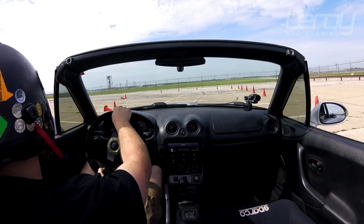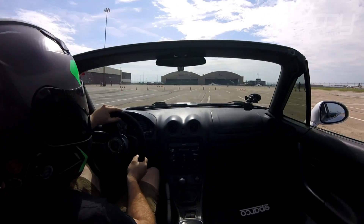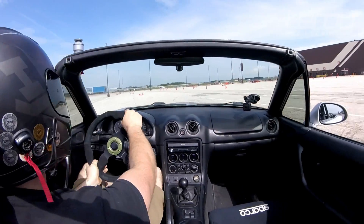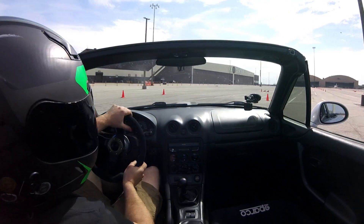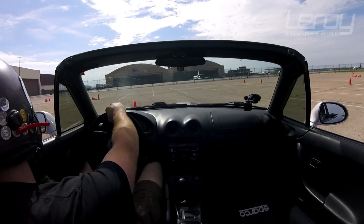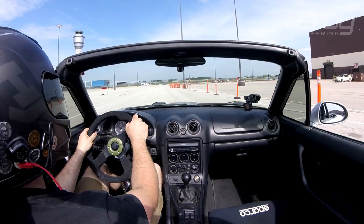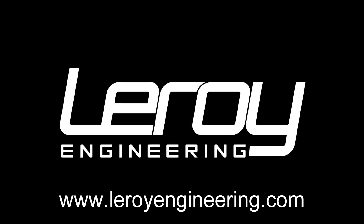So what's the takeaway? While air temperature makes a decent sized difference on a forced induction application, it does not appear to make a massive difference on a naturally aspirated engine — especially not one running on the stock tune with no other modifications. So I'm not going to break my back trying to achieve the coldest air possible, especially if that produces other concerns like sucking in water. The bigger factor in terms of power is correctly controlling oil temp and coolant temp. Too hot and stuff breaks; too cold and you're giving up horsepower. Putting in systems to accurately control those two numbers is going to give a bigger difference in total power output. Hopefully you've enjoyed this — check out our website, subscribe, and we'll see you on the next video.